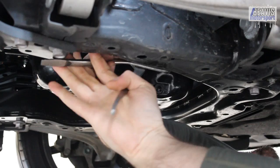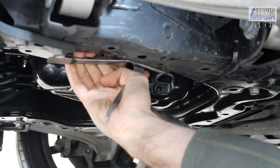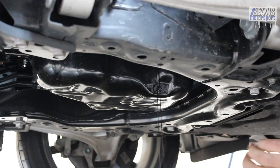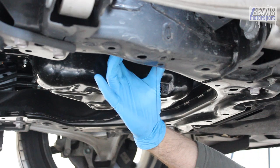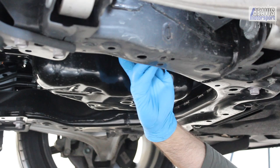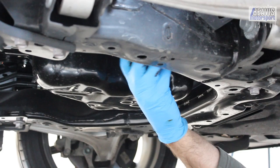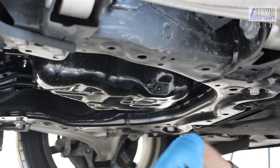Then it's onto the oil filter. Now again this was really quite tight - a lot tighter than I would have expected - so I had to get out my multi-grip and get a proper grip on it to get the oil filter undone. Once it was loose or cracked open, I left it for a moment just to drain the last bit of oil, with the drain pan underneath to catch it. Then I threw my glove back on, loosened off the filter and got that off no worries. You always want to keep your drain pan underneath the oil filter as you remove it, because there is a good few hundred mils worth of oil in there that you need to sort of tip out as you take the filter off.